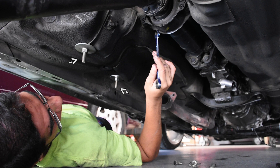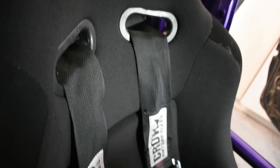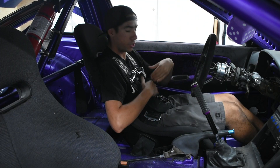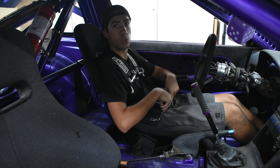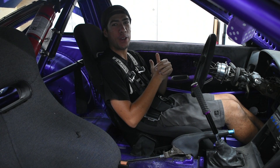Here's a view under the car of how the eyelets look once installed. Take note that there is quite a bit of extra thread on them — depending on how low your car is, this may be a potential scraping issue. If there are extra threads, you can just take an angle grinder to them and shorten them down. To summarize: we have the shoulder straps wrapped around the cage, anti-submarine belts bolted to the floor under the seat using Crow hardware, one lap belt bolted into the OEM seat belt location, and the other lap belt bolted to the floor. Make sure everything is properly adjusted and sits tight on your body — not too low in the crotch area, not too high in the chest — all belts tight. That finishes up the install of the Crow 6-Point SFI Certified Harness.